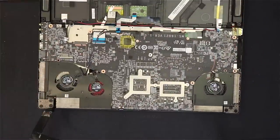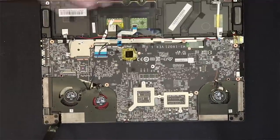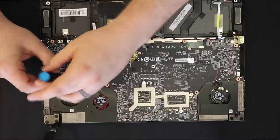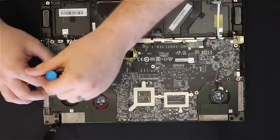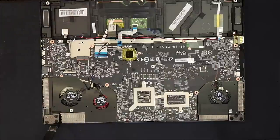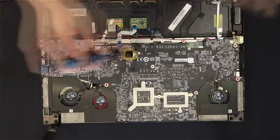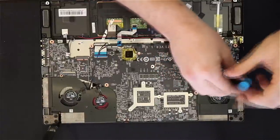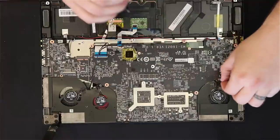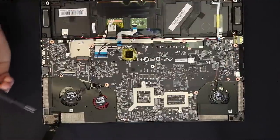The next thing I should go for is the power button there at the bottom of the screen — actually I went for the screws first. You're going to have two screws that are actually holding the motherboard in place, both located right under the fan. With all my screws I have a little magnetic parts tray and I'm placing them down in a clockwise rotation as I pull them out, so when I go back with it it's a lot easier. Okay, the screws are now out.